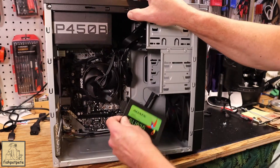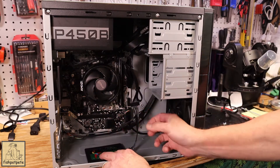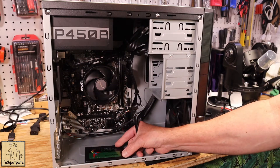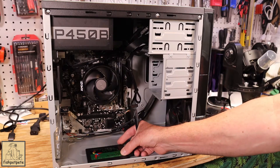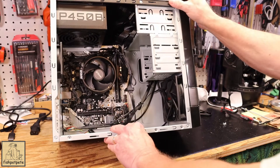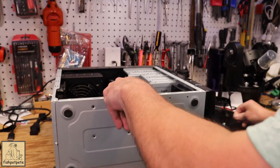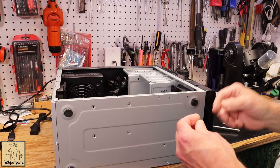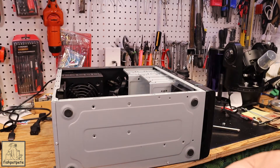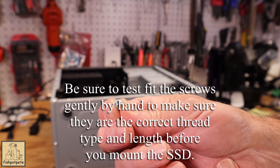It's a really simple matter. I've already got the power connected — just make sure you have enough slack on your cable to be able to mount the drive down there. Then we'll put the data cable in in just a minute. Basically, you're just going to line up your screws. Sometimes the screws are all different sizes, so let me show you the right one.